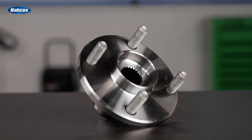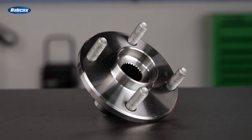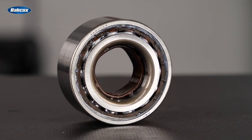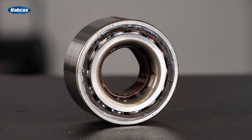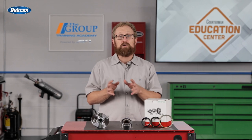Schaeffler's wheel bearing kits ensure that the wheel bearing sits securely in the steering knuckle and remains properly tensioned, and the parts run as true as possible, protecting them from unnecessary wear and premature failure. Depending on the application, Schaeffler wheel bearing kits also might include a circlip, a rolling rivet collar, a low-friction torque seal, or a spur gearing.